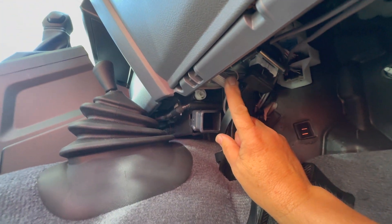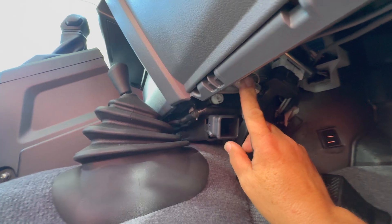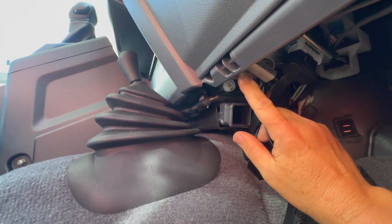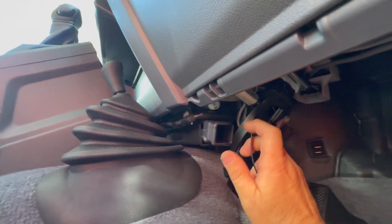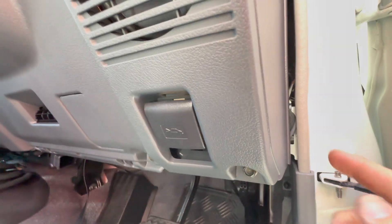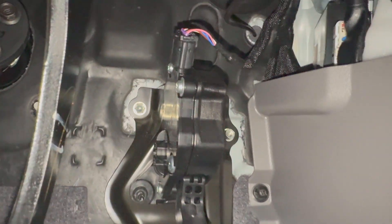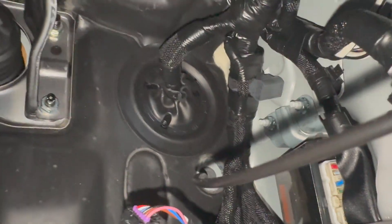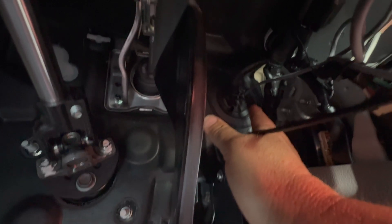You just have to drill one hole with the self-drilling screws to mount the load resistor. That's a good spot because it's easy to get a drill into and you only need one screw to hold it in place, but having it on a bit of metal is a good idea. The other cables route up to the A-pillar for the LED switch, and the remaining cable goes up through the firewall grommet, which is easily accessible in this car.